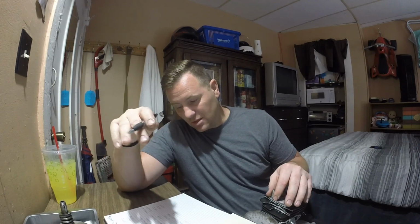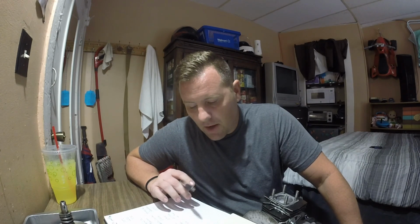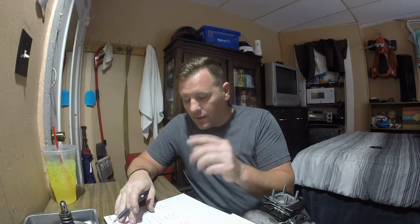So I thought about it and thought about it, and I was gonna let the motor ride as is. 137 intake duration, 108 transfer duration, and 162 exhaust duration. I'm having trouble with that, man. I don't want to leave the transfers that low, but I think I'm gonna go back in. I'm gonna raise the exhaust up and make it more peaky. The intake's 136 duration. I could bring the transfers to a 134 technically and still have what I need or want. But all I really want out of the transfers is about a 114, 116.